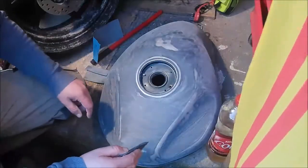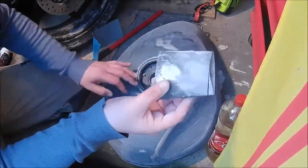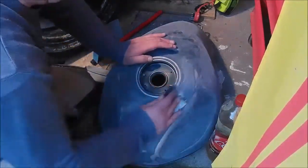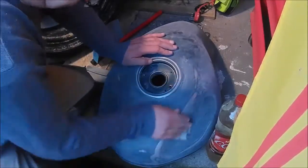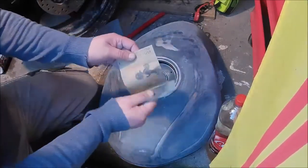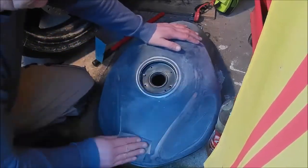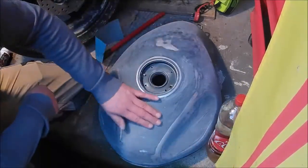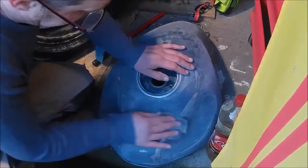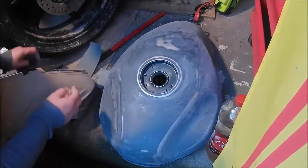Right, you guys, a bit of a bigger angle now, but there's a couple of wee bits glazed on here, you guys, so we're just hitting back to the 150 grit, just to get that glaze bits off. And then we'll go back to what we're using. So guys, I've switched up to 400 now. Get back to it. Yeah, there's just still a little glaze of the blue paint there, and that's all got to come off. There's still a bit there actually. I don't like it.